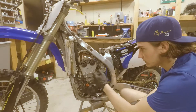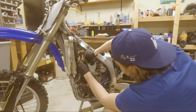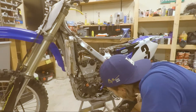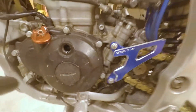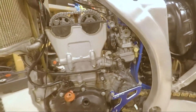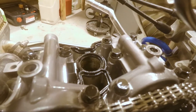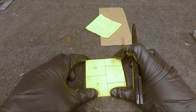There's a little notch in the stator — you rotate it around. I know my bike well enough to know when the marks are right, that's TDC. For TDC, you're going to have a dot here that needs to be parallel with the top of the head, and these little dots up here need to be straight up. There's another mark inside that hole — if you have a light you can shine in there, it'll be lined up with the notches on the outside. Once you get that set, you're going to check the valve clearances using feeler gauges.